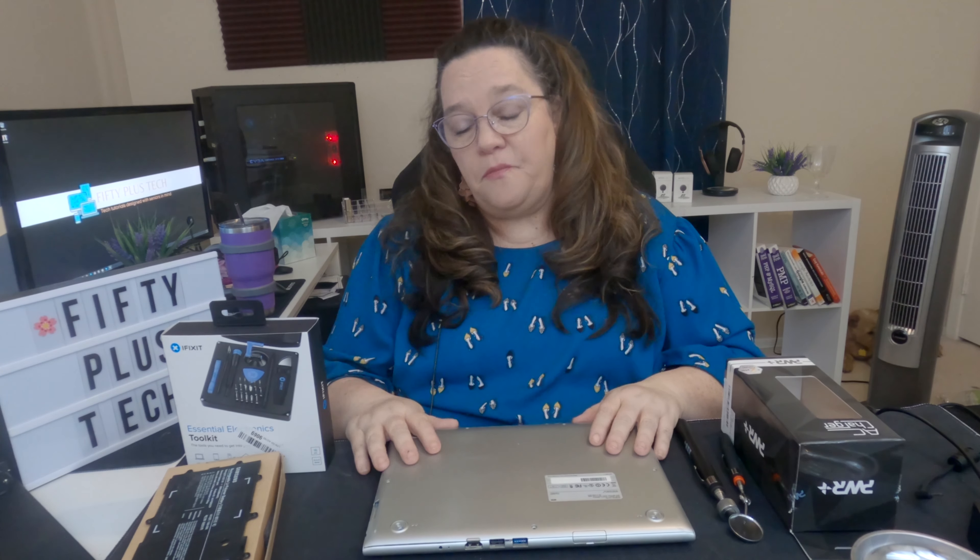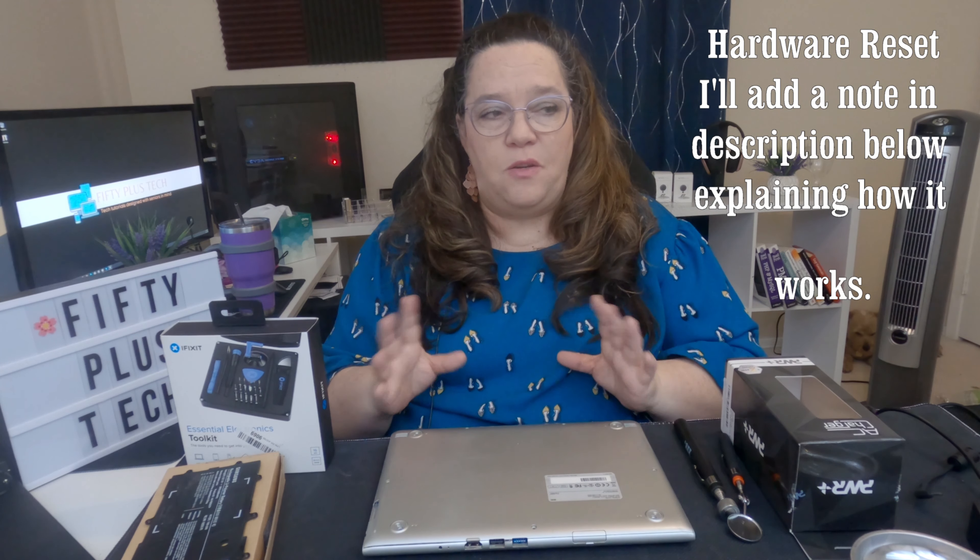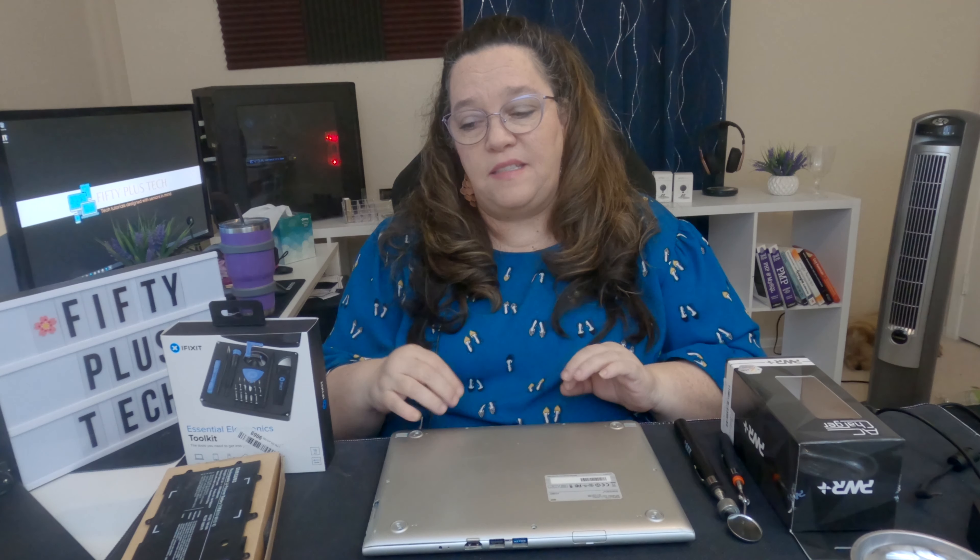The first thing, typically, when you've got an issue with your Chromebook not charging, is to do what they call a hard reset. I'll put the shortcut in the description — I think it's like Control+T or something like that. You can do a hard reset and it basically is as if you had taken the battery out and put it back in, so you don't have to break open the back. If that works and you're able to charge from there, great.